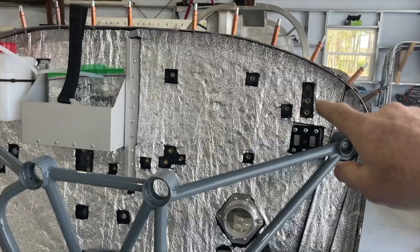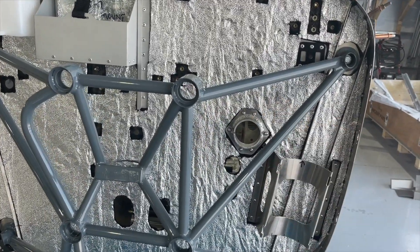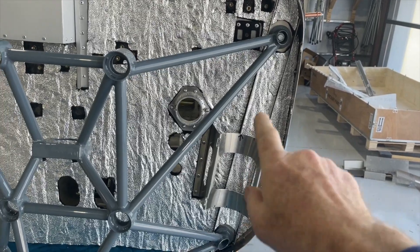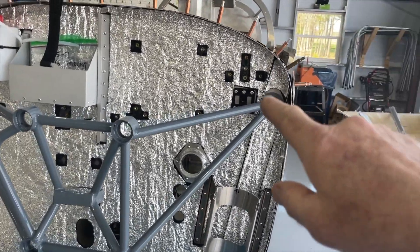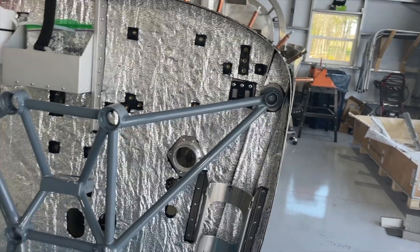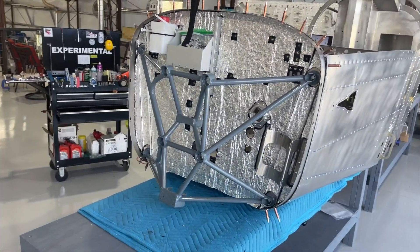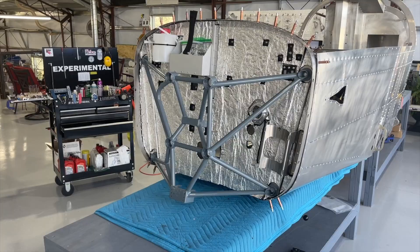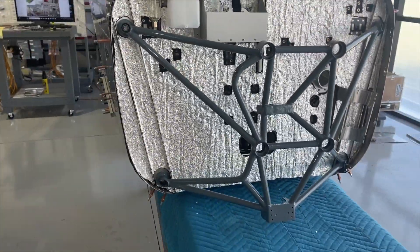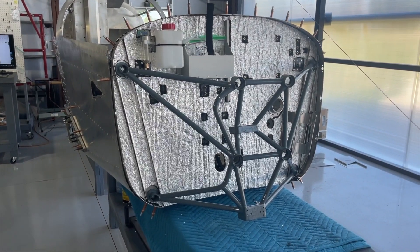I've included a few more things on the firewall: some rivnuts along through here, and opened up some of these areas. This is going to be an exit point for a wire loom, and this is going to be the oil reservoir mount. The engine mount bracket is on, but only temporarily — secured with zinc 5/16 bolts and hardware store fasteners from the inside, only because I'm going to be using this engine mount for the rotisserie. I'm not going to crank down on the AN fasteners until after I'm done with the rotisserie, and then I'll use the regular AN-5 fasteners for the final mounting of the engine mount.